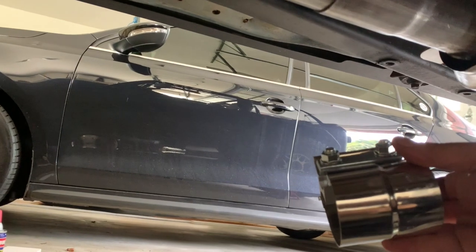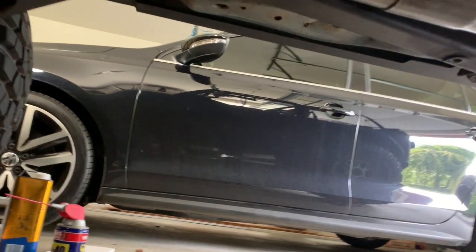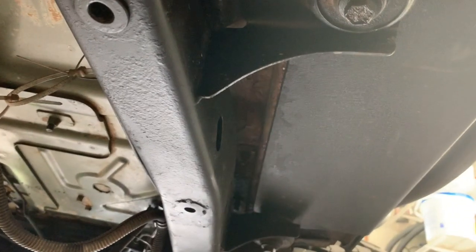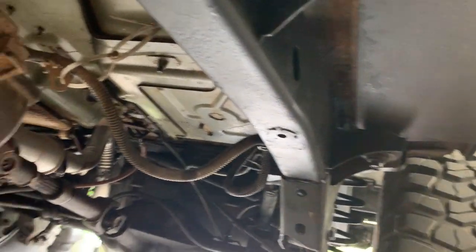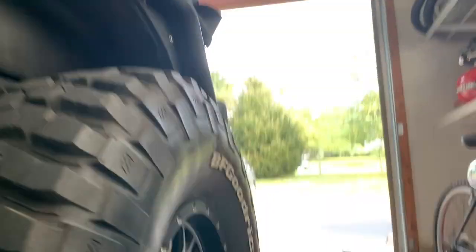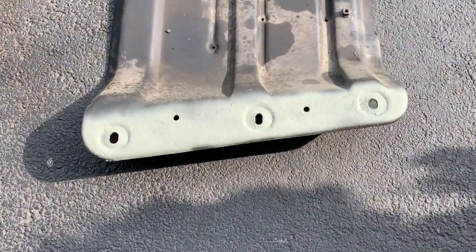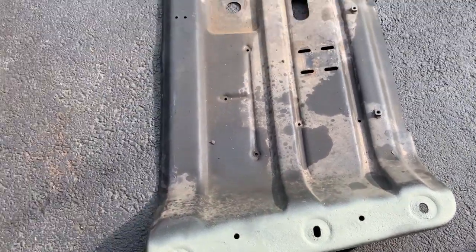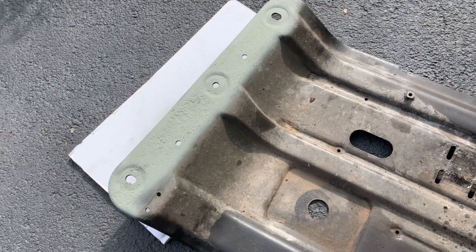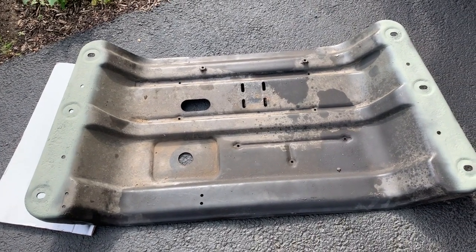So I'm just going to take this piece apart and slip it over — could have saved myself some time if I wasn't rushing and was thinking a little bit. One more thing I noticed: I had a little bit of rust between the skid plate and the frame rail. I had these frame rails painted inside and out, but there was some rust there. So I wire brushed it and put a coat of Rust-Oleum on. I've used POR-15 — that's a whole different subject — wasn't super impressed by it. There was a good amount of pitting on the skid plate, so I took a drill and a wire wheel, got it down almost to bare metal, and sprayed some self-etching primer on there. That's ready for another coat.